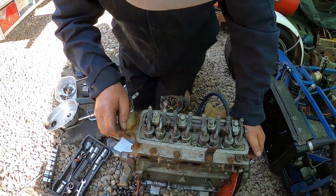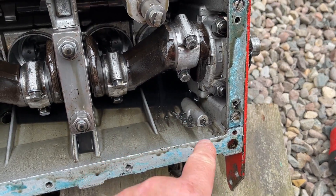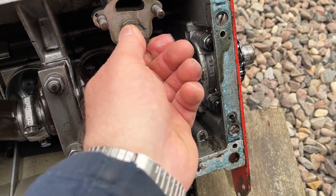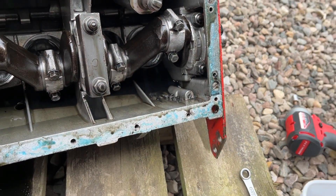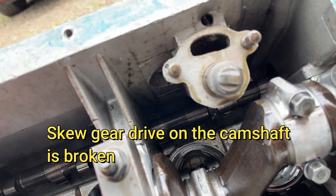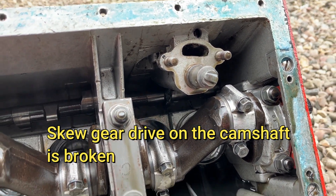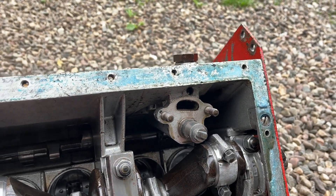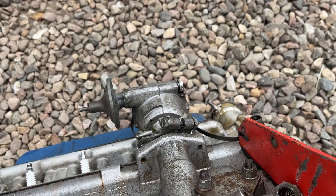Little springs look okay. Bits of gear in there. The gear from the drive of the camshaft - oh yes, camshaft gear's away. And for some reason I can't get the distributor out. It's jammed in there.